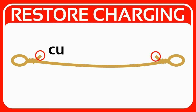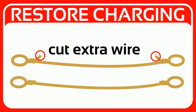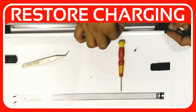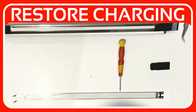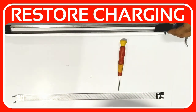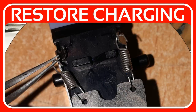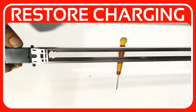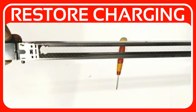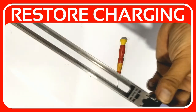Repeat this process, then cut the extra wire. After cutting, the corona wire is now ready to use. Simply install the corona wire and springs into the unit with the help of tweezers and cover it. After covering, install the corona grid very carefully and tighten with both springs. Now the charging corona is ready to use. Please feel free to ask any question — I really like to assist you.